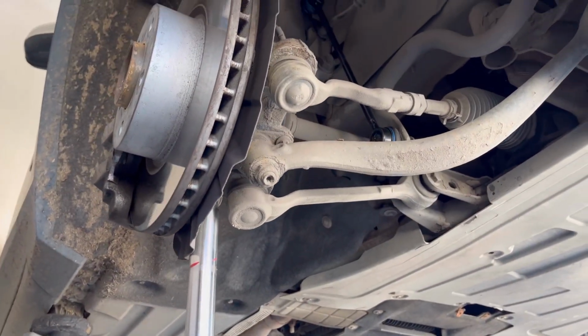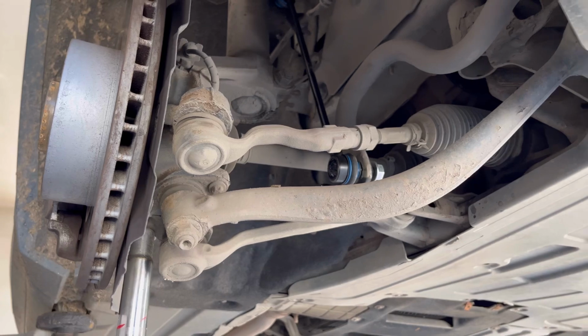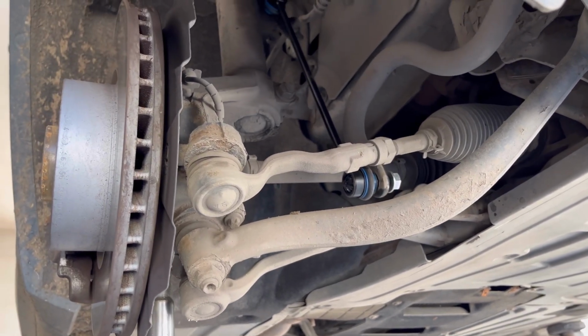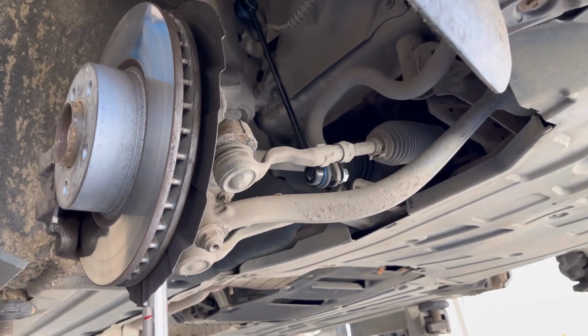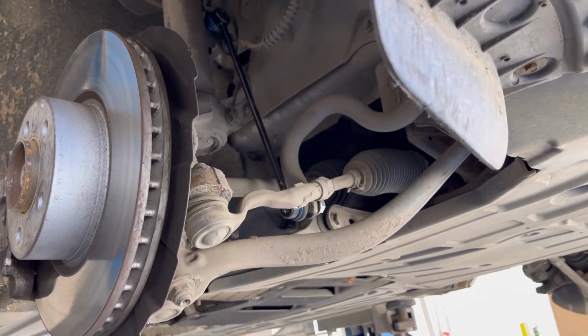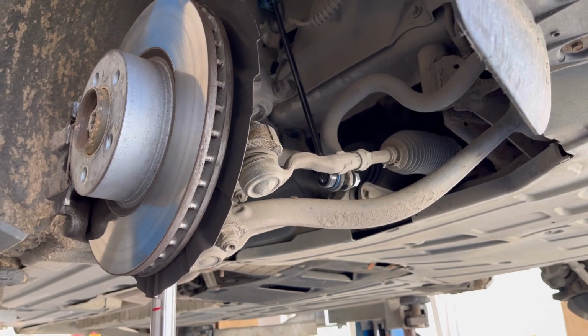So what I did here is I pushed up the front right wheel, and now I'm gonna tighten the sway bar end links. Maybe you don't need this. You can just put up the wheels on the car and let the car down, or maybe you are doing this down. That's good. And it's very important to have weight on the wheel